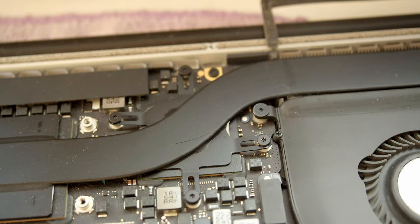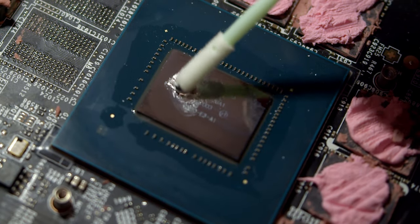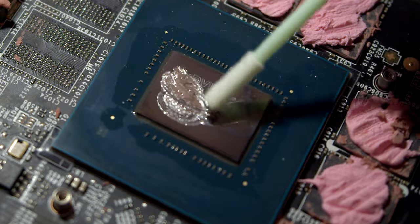If you don't do anything stupid — disconnect the battery, coat everything conductive around the CPU and GPU, and take care of VRMs — then your laptop is probably going to be fine and you can be sure you played as safe as possible. If you want to see some actual numbers, there are two more videos coming where I replace thermal paste with liquid metal on a 2015 15-inch MacBook Pro and MSI Creator 15 OLED, which is practically an MSI GS66 with an OLED display. I will also monitor performance and, if I don't forget, make a couple more videos answering whether performance changes over time and if liquid metal needs to be reapplied after a while. So that's probably it — thank you for watching.